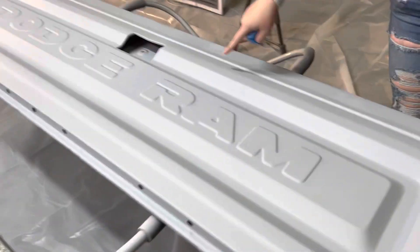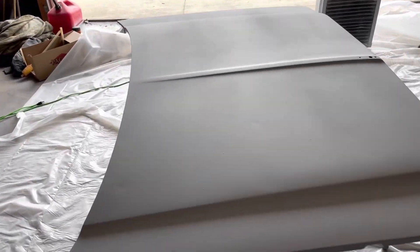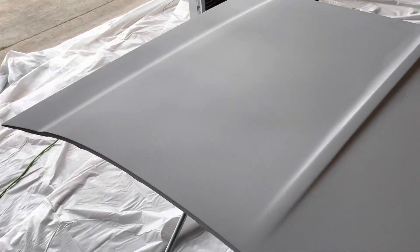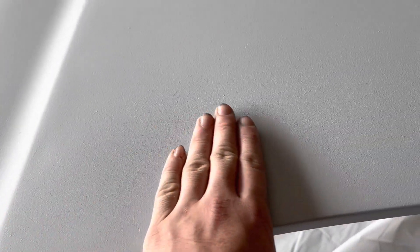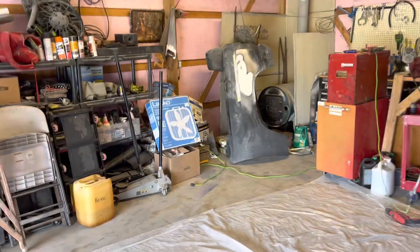So I'll see you guys tomorrow. Oh my gosh — good thing I cut that camera, that just dropped. Well, we got that primed, hopefully we didn't mess it up. We know we can't leave them painting that long. The hood gets two coats on it now. All this stuff will sand out — the first sandpaper I use and then we'll go on to using different grits. Sand that all out. Hopefully we only have to prime little sections before painting. Main goal now is to get those fenders primed and the other hood hinge and the bottom of the hood.